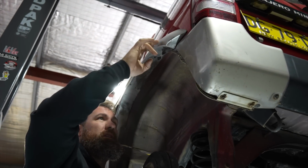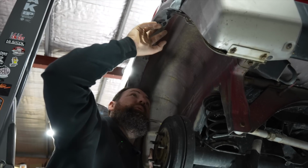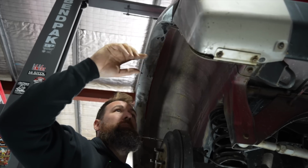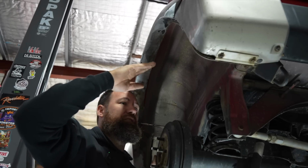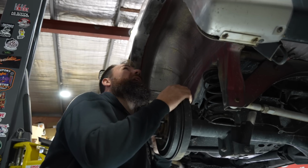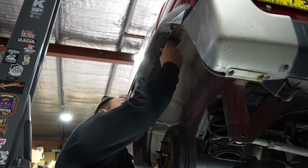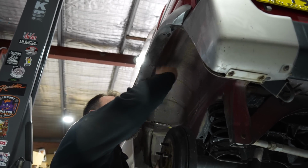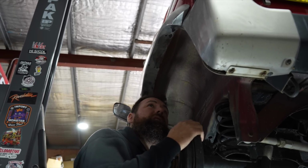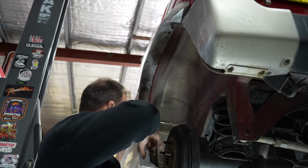You can understand putting this flare on now why some of these holes actually blew out, because realistically there's probably about 10 mil missing off that inner edge on where it should be. For whatever reason, I don't know if the manufacturer made it short or the previous owner cut these too thin or what, but yeah, it's not great. We'll make it work, but it may just mean we'll have to drill holes further back and potentially glue. It may just mean gluing this section rather than riveting it. Not super keen to glue them on, but I also don't want them to fall off, so I probably will just glue kind of from there to there, and then the rest will just rivet.